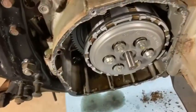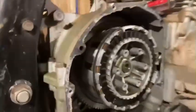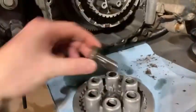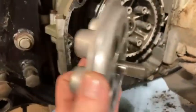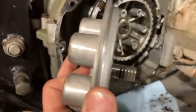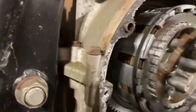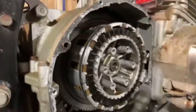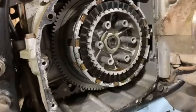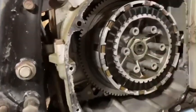With the cover off — we're obviously going to need a new gasket — we're pulling these springs off to take a deeper look. With the spring plate off, I expected something more complicated but basically the shaft sits in here and the spring interacts with the lever to take pressure off the clutch plates. Everything looks good but a little sticky, so I'm actually going to pull all the plates out, hit them with a little oil, and put them back in just in case there's some dryness in there.